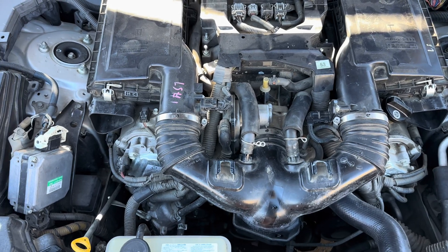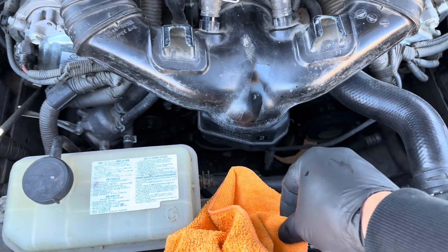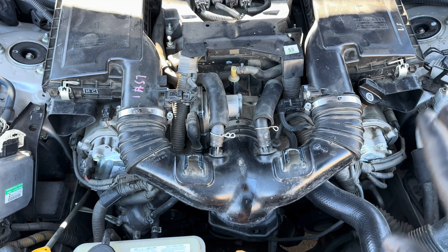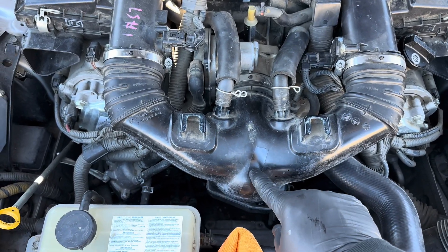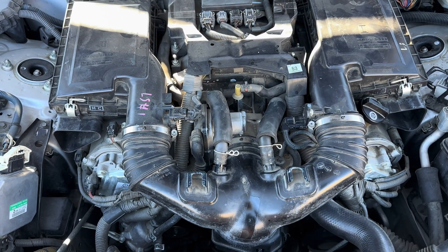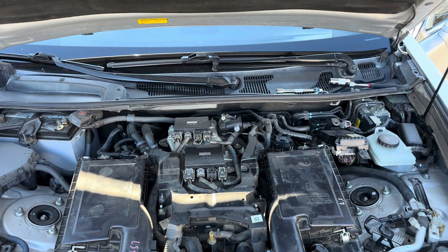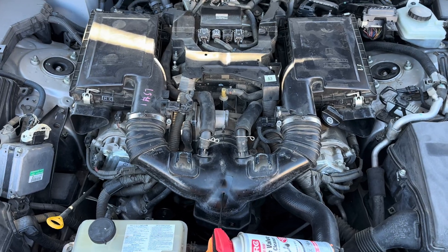We temporarily put her back together to run the product through. This is optional, but something I do to my cars regularly: I'll go ahead and drill a hole and use some Scotch 33 tape to seal the straw through, then put a plug on that hole between services. So at each oil change I can just plug in there, squirt it in, run it for a while, get the oil nice and hot, change the oil — I don't have to disassemble everything. A little cheat code for a direct shot into the intake. Engine's warmed up — make sure you don't do this with a cold engine. Get a helper to hold it to about 3,000-3,500 RPM and run one can, then the second can.